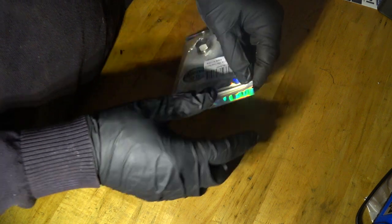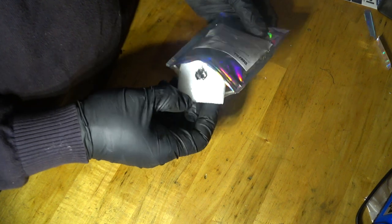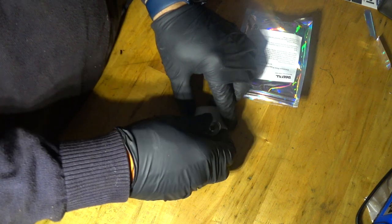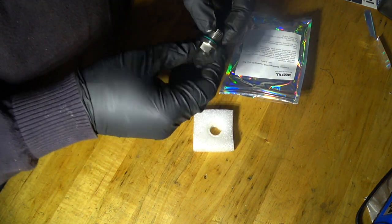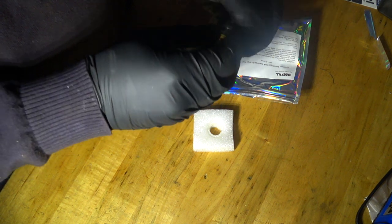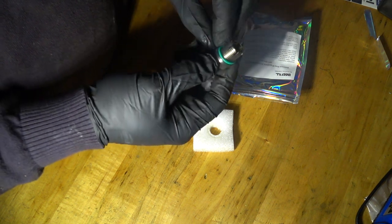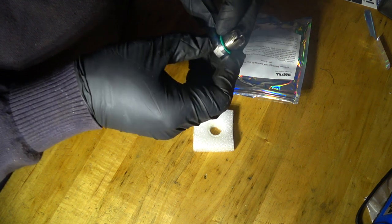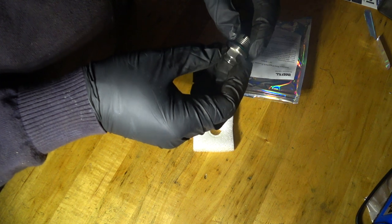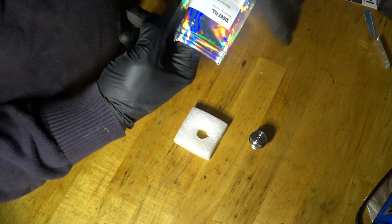So let's open this so you can see it. This is a multi-part plug. It has the main plug here, as you can see. It has these notches here, so it self-threads into the hole. It has this O-ring. This O-ring is good up to 400 degrees C, so no concerns there. And then it has the inner plug, which is the one that we will be using from now on